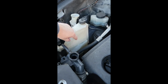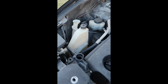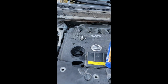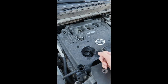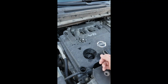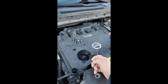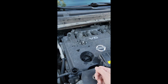And indeed, I had seen the coolant reservoir bubbling a lot. When I come from work, I lift the hood just to see. There's a lot of bubbling. It doesn't make a lot of white smoke while running, but recently at the start it does. Quite a few times I try to start it until I quit on it, call work and can't go to work. There are times that it takes 4 or 5 tries and then it goes.